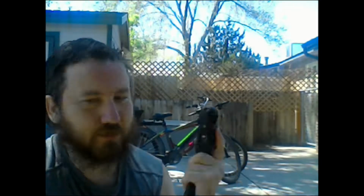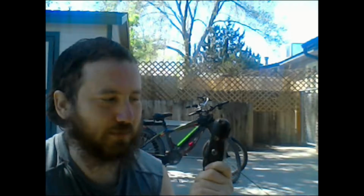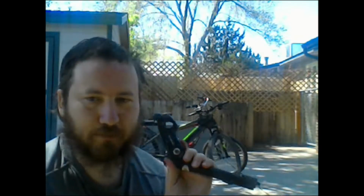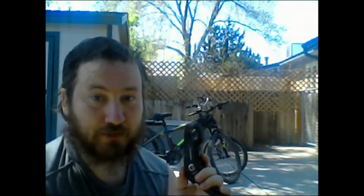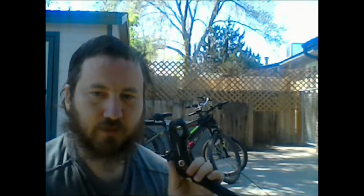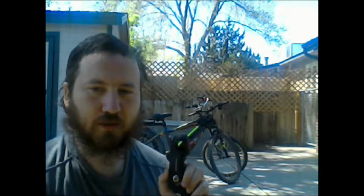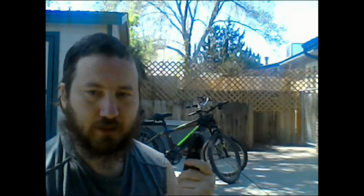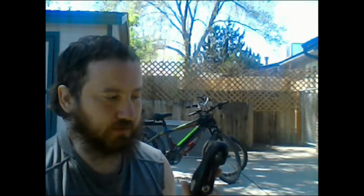And for anybody wondering, I know this is only a two-screw piece, but that's all it needs. It doesn't need that much, because again, this has much more metal to it, and it can be torqued down a lot harder, even if it's using a smaller diameter piece around here. That actually has a lot more metal because it's more confined. Threadless systems have bigger tubes, but not as much metal because they're wider. So torquing them down harder is going to crack them or cause other problems, compared to torquing one of these down, and you have no problems.